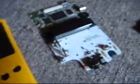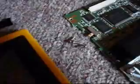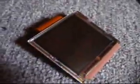This is a little metal piece for the game cartridge to slide through. Those are the screws that held it in. Those are the screws that held the casing together. This is the infrared cover. And over here is the logic board. Right there are the screws that held that in. There's the screen. And over here we've got the buttons.